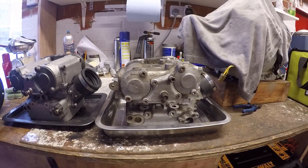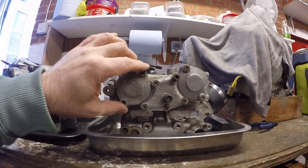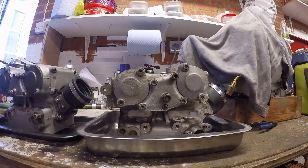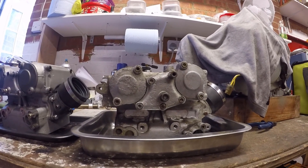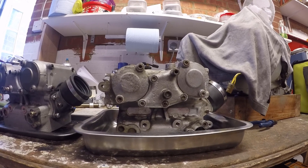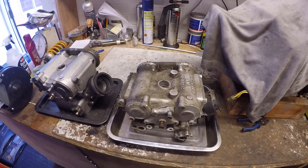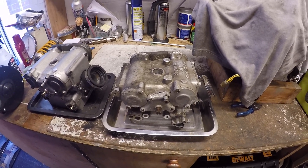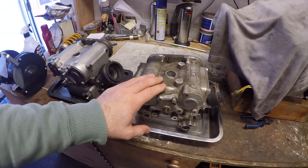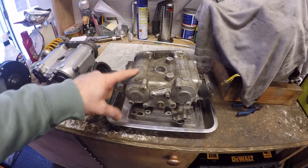These were found on Monsters more often than not. The reason for finding these on the 748 is that Ducati looked to standardize the head production range. The rest of the Superbike range had moved on to the 996R and then the 998 onwards, always using Testastretta heads and engines. What they had left was an anomaly in the 748R — it was the last of the run using the Desmoquattros, and they weren't selling enough to justify producing two styles of Desmoquattro heads. So they used the same casting as they were using for the Monsters, which gave this lower head.